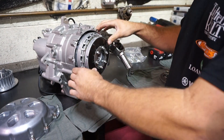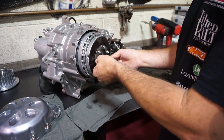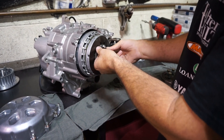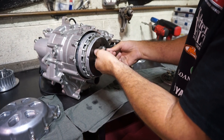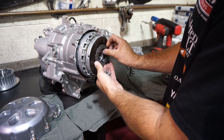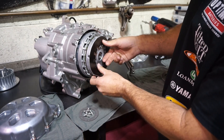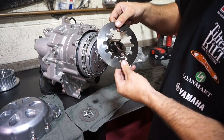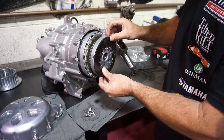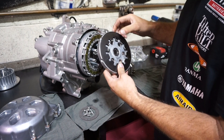Once you get the clutch cover off, basically you have your pressure plate — you'll just loosen these bolts right here. This is basically just a distribution washer held together by the bolts, and then you have your little pressure ring right here. Instead of springs, this is how the factory applies pressure to the pressure plate. Then the next step is the pressure plate itself, which goes right on the friction disc — that plate pushes on here, that's how it gives you your pressure. That's how it is stock.